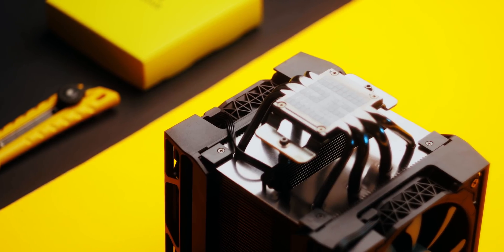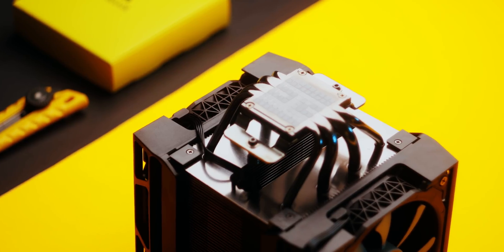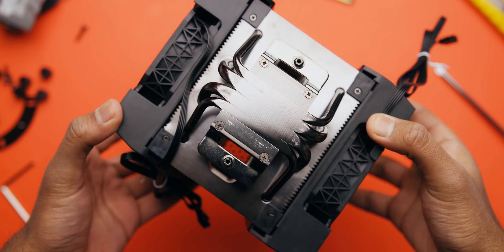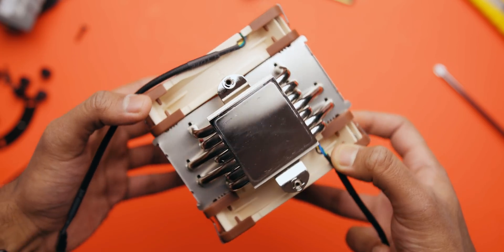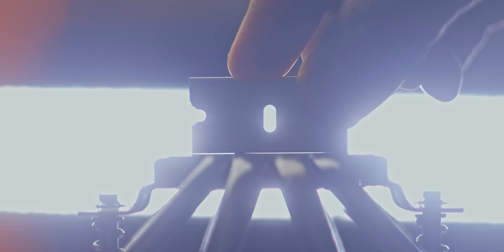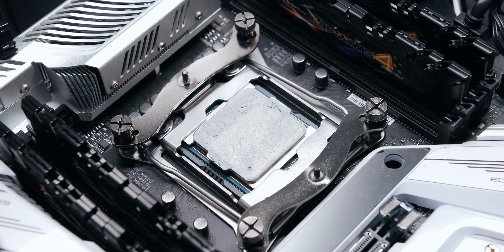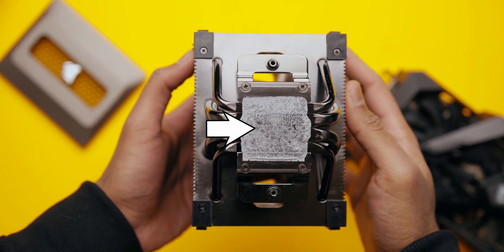The heat pipe direct touch base is also a bit odd, since Corsair says that the A500 can handle heat loads up to 250 watts, but usually this type of design is used for coolers with lower ratings. Most of the high-end heatsinks from Cooler Master, Deepcool, Be Quiet, and Noctua have more traditional bases and they look really good compared to Corsair's offering here. Another issue with this type of base is it's very hard to get a good contact between the IHS and the cooler, which becomes pretty evident when you put a straight edge on it or after the heatsink is uninstalled from your CPU. We've seen three A500s and every one has a minor base variance, so it isn't unique to just one sample.